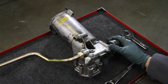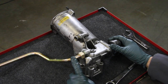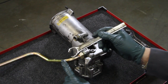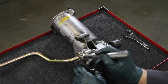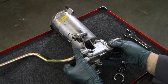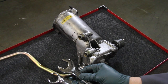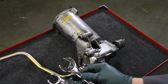To remove the oil filter housing from the engine block, you will need to remove these oil cooler lines, and this can be one of the most frustrating parts of the entire job. I came up with a special wrench that I make here in my shop, which will allow you to go over the top of this line and grab ahold of this nut to loosen it. Without this wrench, it is very difficult to remove and replace these oil cooler lines. This wrench is not included in the kit, but it is available along with the stub section on my website and can be purchased separately.